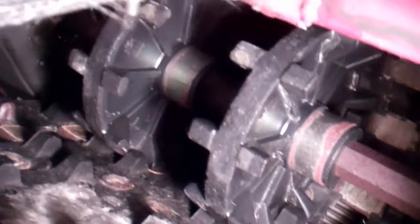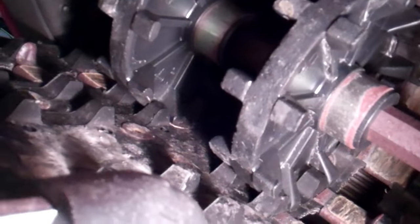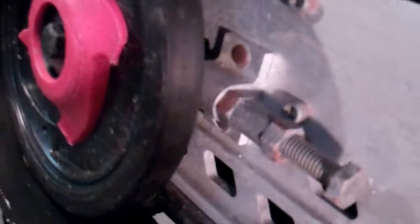We've got to take this whole undercarriage out with these four bolts right there, two on each side. After looking it over closely, I don't think I have to take that snap ring off. All we have to do right now is unbolt the carriage and slack off that nut on the bogey wheel to reduce the tension on the track, and we can take this undercarriage right out.